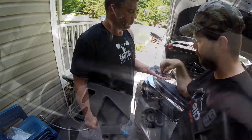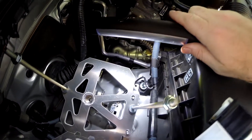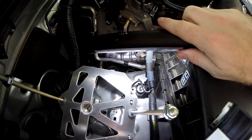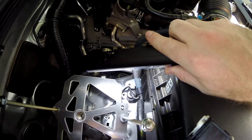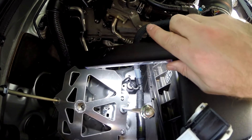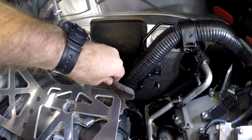The larger rubber bushings are going to go up against the side of the truck, in between the bracket and the truck. It looks like we're going to be able to route the ground right down underneath the bracket with plenty of room. We're going to put a little bit of extra electrical tape around the wire to protect it from abrasion on the battery tray itself. We're also trying to find materials around the house — the best thing so far is this foam pipe insulation.